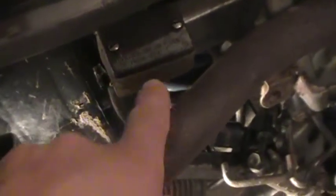The brake reservoir is easy to take off while riding, but I need a new one because it's leaking out on the ends and it's plastic — so it's obviously failing. The brake fluid leaks onto the exhaust and blows white smoke, so you might think it's the motor burning, but it's not.